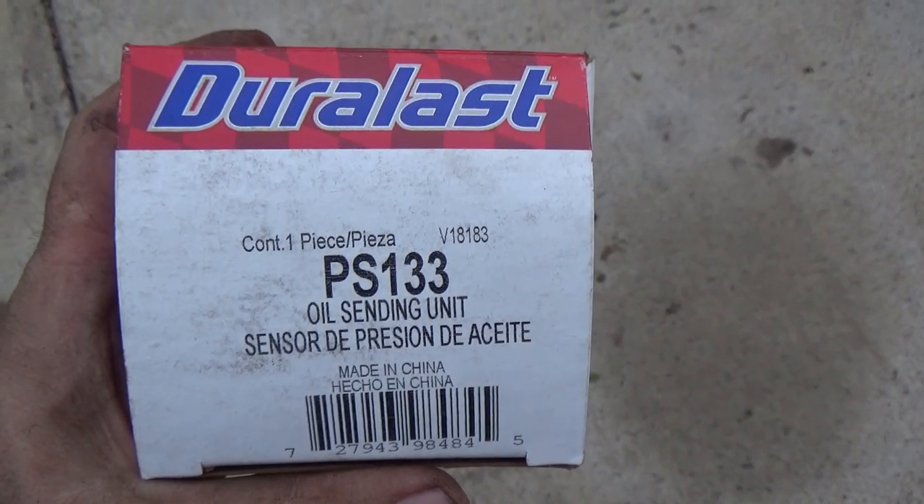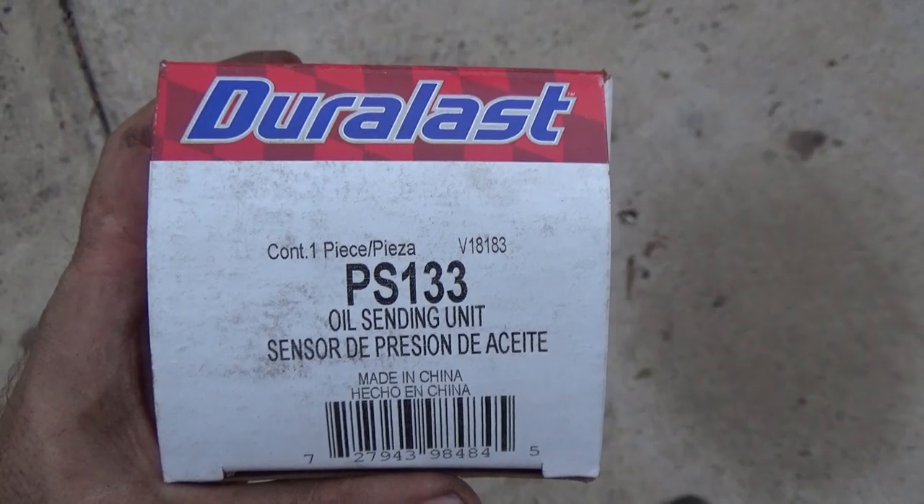Just in case you're curious, here's the part number: Duralast brand, PS133. Those of you who haven't seen the oil pressure sending unit video I'm talking about, I'll put a link down below in the description or up in the corner there'll be a pop-out card. After seeing the inside of an oil pressure sending unit and seeing that it's a potentiometer or variable resistor — seeing that you've got a copper arm that slides back and forth inside there that varies the resistance sent to the gauge — the only thing I can assume is that there are bad spots inside the switch where that copper arm slides. With it varying, sometimes it works, sometimes it doesn't. Maybe it depended on how hot it got, because heat causes things to expand, and that arm could be coming out just enough to lose contact in certain places.